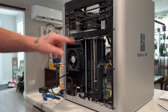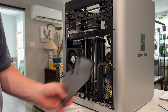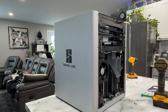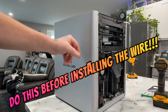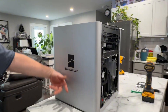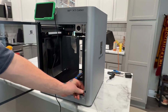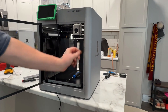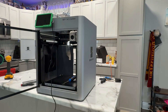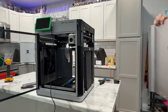Now it's time to put all the screws back in, throw the trash chute back in, and get this thing going. So then in order to hook the actual heater down, you've got to take the side cover off — this is an X1. You're going to take these four screws out: there's two in here that run this way into the side, then come around the front, pull these two tabs back — there's one here and one here — and there's two screws kind of angled in there. Then you can pull the side off.